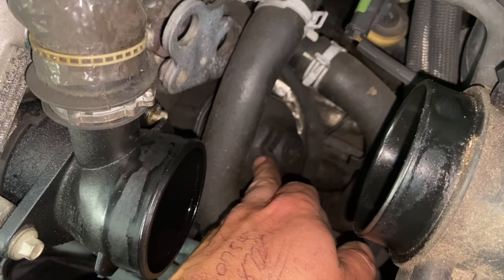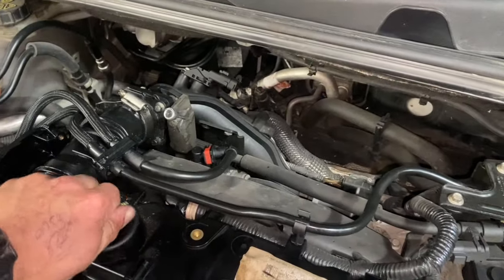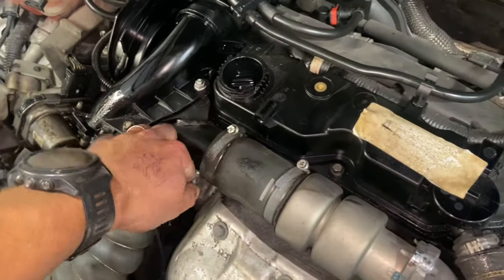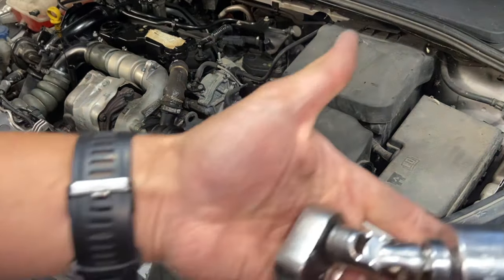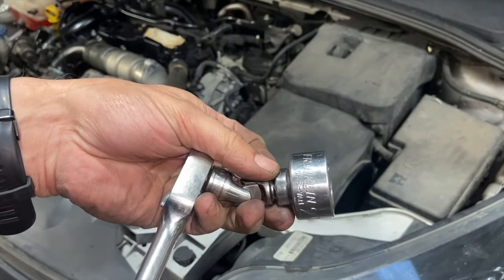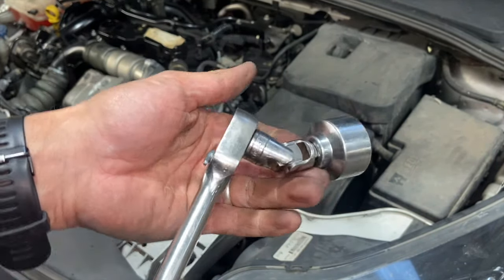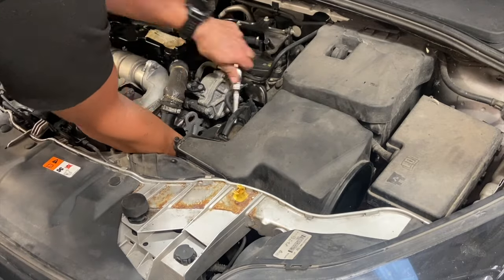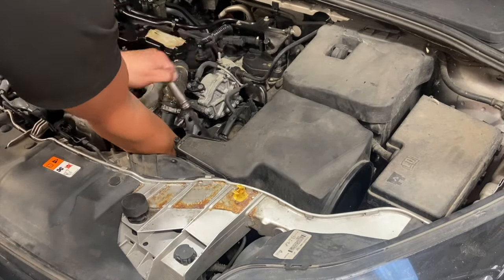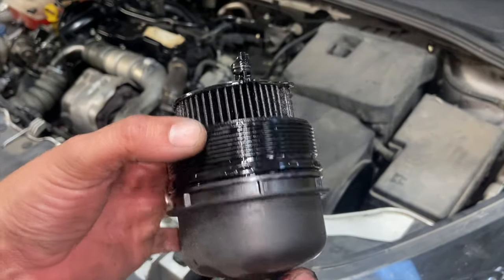The next thing is the oil filter — I think it's 27mm on there. That's just the cover for the oil filter; we'll take that off and get the filter out. Just undo the filler cap and pull the dipstick back slightly as well — that way when we're dropping the oil it'll just allow it to run a bit better. The oil filter cap is 27mm; use one of these low-profile filter sockets — quite a handy tool. I've got a link in the description below to them. Using a swivel socket and swivel extension on there just to make access a little bit easier.